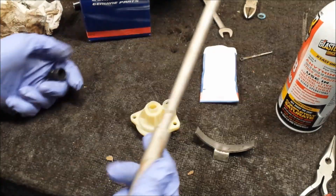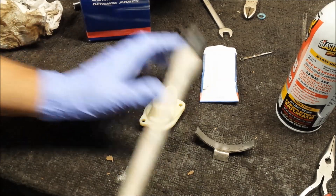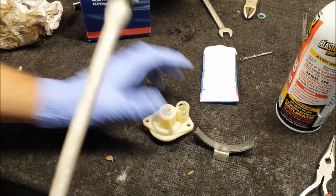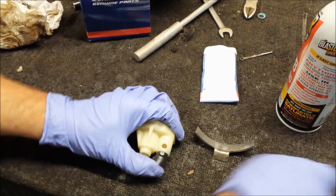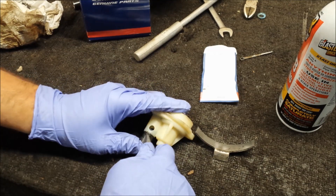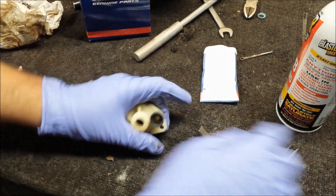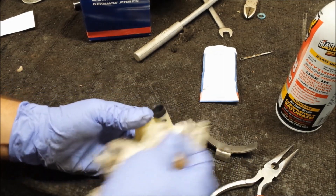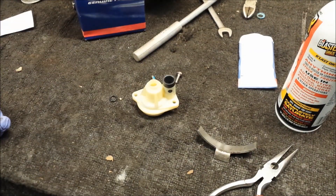I've got a tool for this somewhere — let me see if that'll work. This is a grommet installer tool for a 20 horse. The grommet's the same so in theory this might help. Okay, that ain't doing nothing. I guess this just holds it for you and puts it in the gear case and then you fight with it when it's in there. But it doesn't look like this is some mysterious goes-right-in kind of tool. Nothing you could hope for, right? Back the old fashioned way. Now you don't want to pierce through the rubber here — you just want to push it in. Perfect. Who needs that tool? Now we get our screws and our little o-ring — that's the end of our water pump kit. Let's go get this installed.